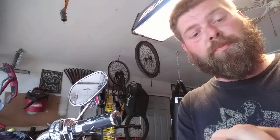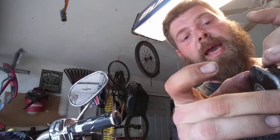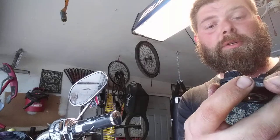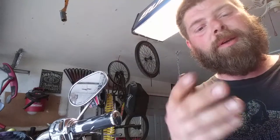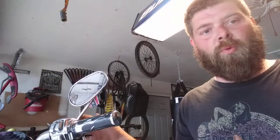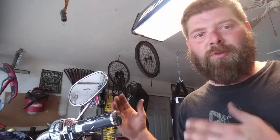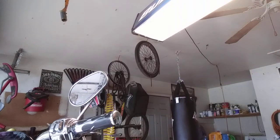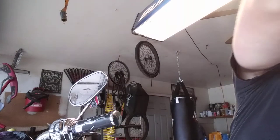Harleys are a little bit different, where the boot and the cap are kind of one piece. You can buy just the boot, or you can buy the whole new cap. You can usually clean this boot up pretty well. They're made actually a little bit better than the cheap little ones that go in Japanese bikes, which you do have to change every time you do a brake job or flush, because they're a thinner rubber. But you gotta have a container to put your brake fluid into.